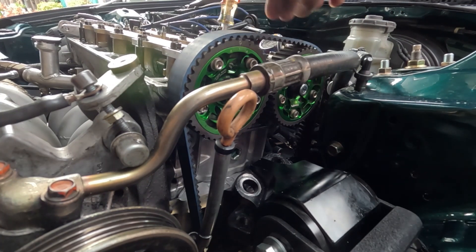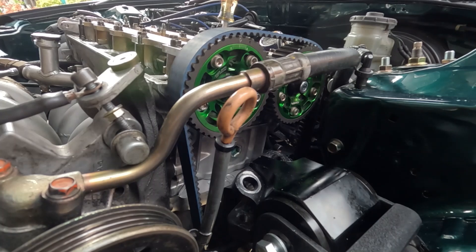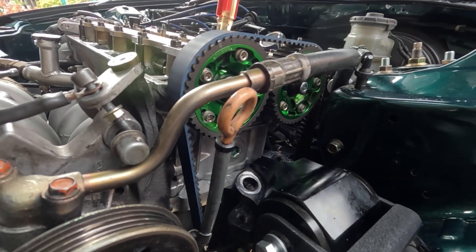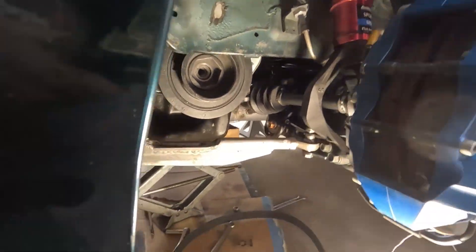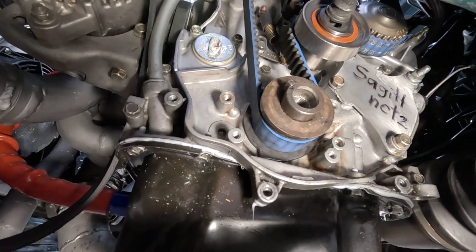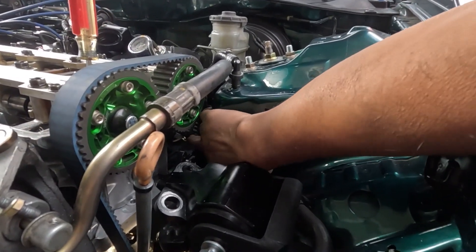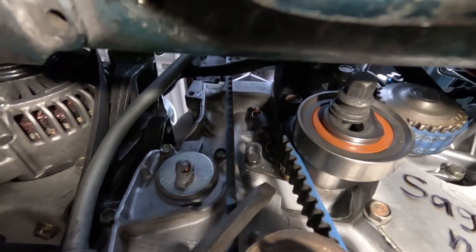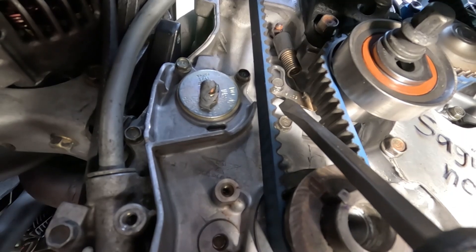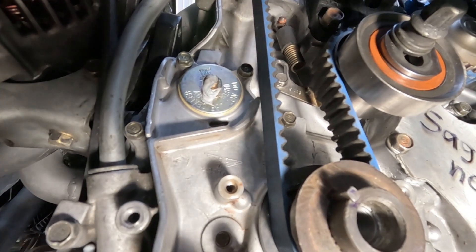I still have a little bit of slack here. I can get rid of this by doing it another turn, and that's what I'm going to do. All right — three teeth: one, two, three, right there. Same procedure — loosen the nut and the maintenance bolt — and hopefully I can get rid of the flex on this side. If you paid attention the first time, there was a gap here; the spring would not pull it anymore, so it just needed a little bit of a push to tighten it.